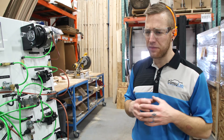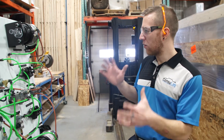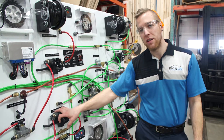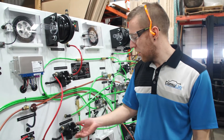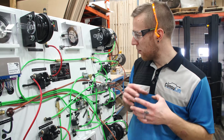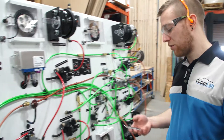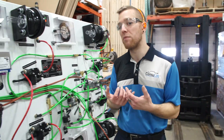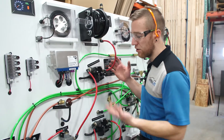One of the biggest advantages of the product is not only being able to do the driving simulation but getting access to all the components. When you want to talk about a modulator valve and show it to your students, if you've got an entire bus in front of you, you might be lucky if one student can really see where it's at. With this trainer you can get in to each individual valve, even remove the valve and pass it around. One of the first assignments we give students is to take off all the magnetic labels and identify all the components on the board — just doing that helps students learn faster when they get to the real bus.